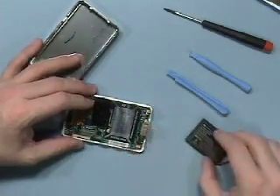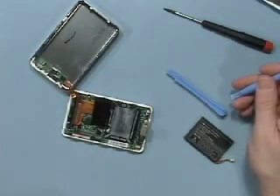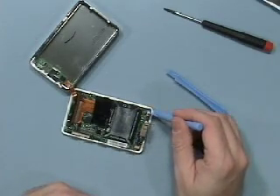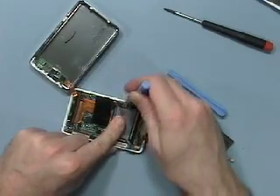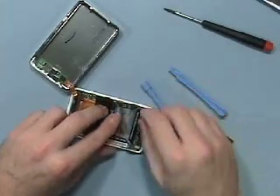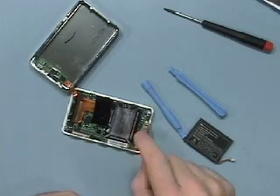Here's the original Apple battery. This can be a very difficult item to remove, which is why we do recommend dealer installation for this product. This battery is glued in with two adhesive strips, one on each side, and the wire actually goes underneath the logic board. To remove it, take the small tool it comes with and get underneath the battery to lift up on it. You may want to try heating the battery with a hair dryer or an industrial heat gun to release the adhesive.